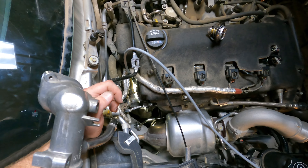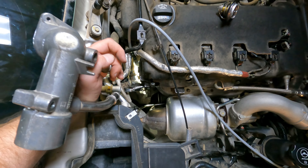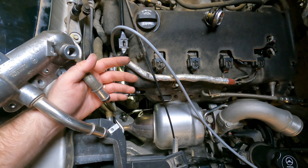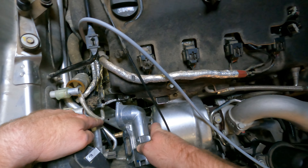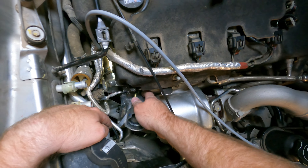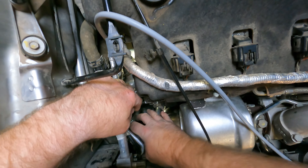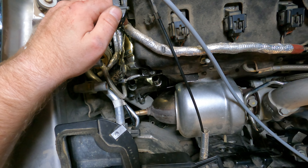I thought I was done, but it's taken me at least five tries to try and film this video of how to put this thermostat housing back in here. So I thought I would try and record it so anybody who wanted to could get a better view of it. Basically this thing has to go in with this side down — with the short side down — and then it has to somersault and come out right side up. First you put it in like this, make sure that short side goes to the other side of the O2 sensor there. You can bring it in behind that electrical connector there. Then you're going to want to tilt it forward, reach in here, and push that other half of the thermostat housing out of the way. And boom, there you go — right where it needs to be.